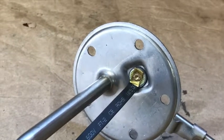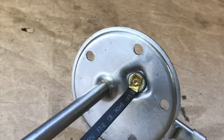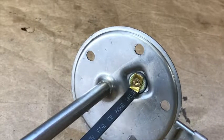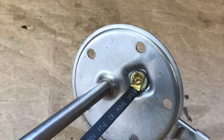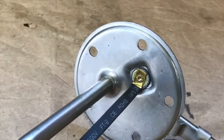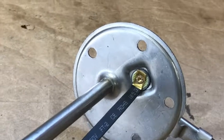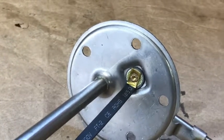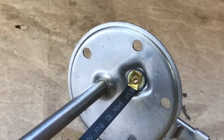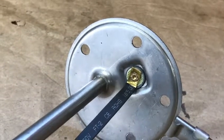When you're only dealing with 12 volts, which is a rather low voltage, and you're only dealing with 30 ohms maximum, you need a pretty good connection. That wire is probably 20 feet long by the time it leaves the tank till it gets to the gauge. You've got 12 volts pushing a signal and almost no connection. With only 30 ohms to signal the gauge different levels from zero to 30, it's got to be a pretty good connection. And it wasn't.